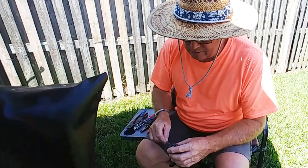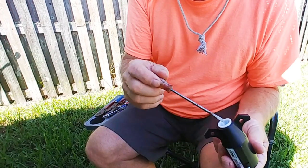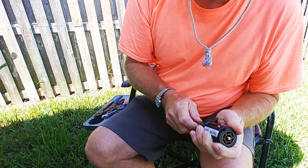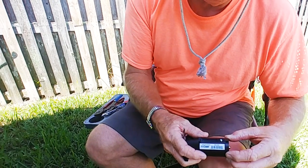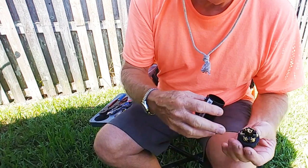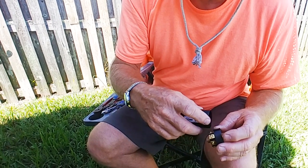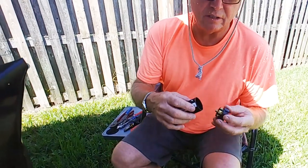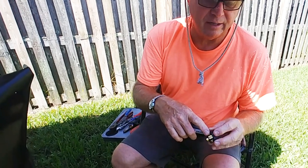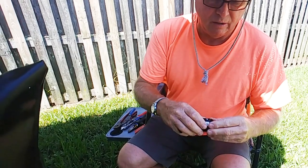This screw here comes out on this plug. The way this thing works, I just push it — there's a cable lock where the cable goes in and a grommet right there. I push it and it pops out. It's got a pin guide right here so this thing goes in one way, and it's got a key lock when this screw tightens down. The snug-tight parts are all plastic; the only things that need good torque are the wire terminal screws here. That's the plug itself, the way it comes — it goes right back in there. We'll hook it all up and I'll show you the different aspects of it.